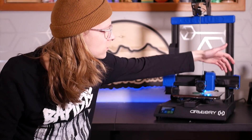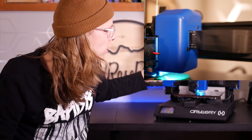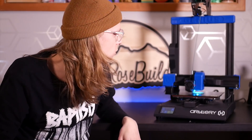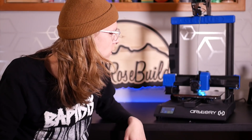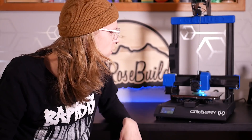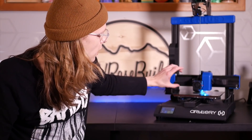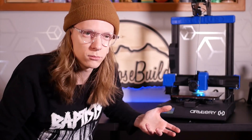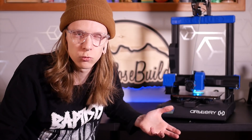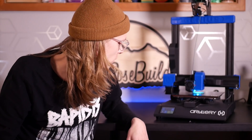As you can see, the extruder assembly is connected via a ribbon cable on the X-axis, which is great because normally there's a large amount of wires coming out of the extruder assembly. That keeps everything nice and clean. It's a pretty robust cable — I don't think it's a point of failure, but they do include extras if it does fail. The X-axis itself is a single piece of 20 by 60 aluminum extrusion, which is more rigid than the 20 by 20 we see on a lot of printers.